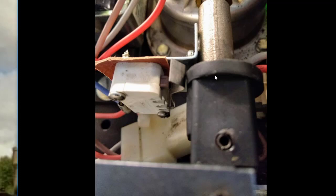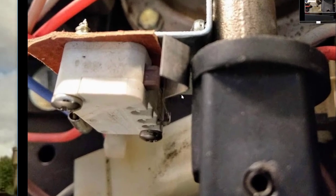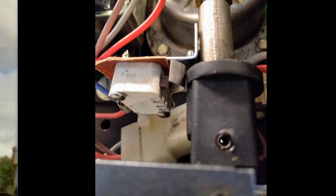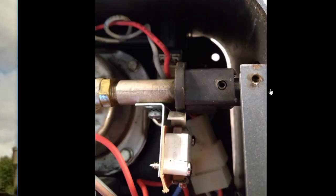The trick is: you close the little knob, adjust this piece, and then tighten it so that there's a little space right in here. This piece should not touch that tab at all when it is closed. What happens over time is as you turn it on and off, the nut slips a little bit on the shaft, and this piece gets closer and closer until it's just touching that tab — and that's when it starts to drip. It barely has to touch it at all to start dripping. That tiny space has to be maintained.